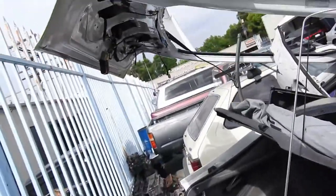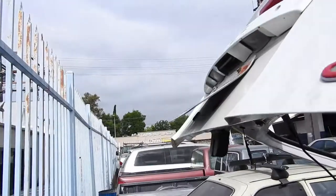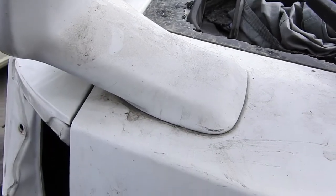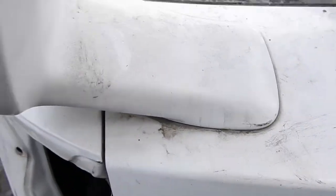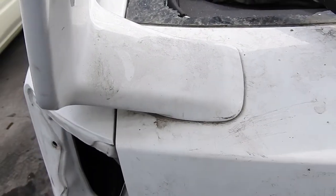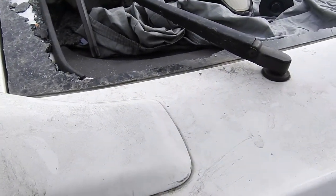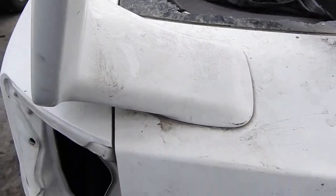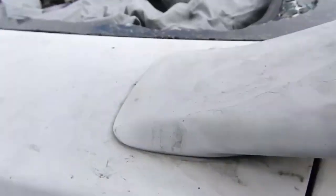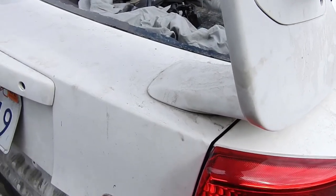After that you have a plug — this plug is your brake light for the TRD wing. Once that's off, the wing is still kind of stuck on there. As you can see, I'm pulling on it and it's pretty stuck — that's because there's double-sided tape. People have used dental floss or fishing line to get through it. It helps if you use a heat gun or work on a hot day. I'm gonna try dental floss right now, and if not, I'll have to get fishing line.